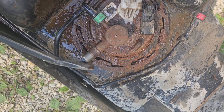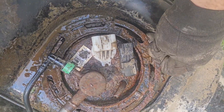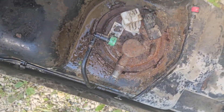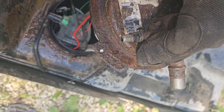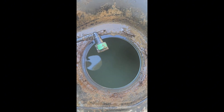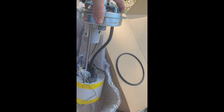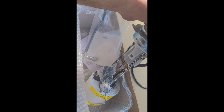We can slide the ring out — you're going to hit it counterclockwise and then the ring comes off. Then we'll just pull that old pump right out. This is a great time to dump your tank and get any dirt that's in there. Now getting ready to put the new pump in — got a new gasket for the pump. As stated earlier, you will need to unplug your sending unit from your existing pump, or buy a new one, and install it on this new pump.